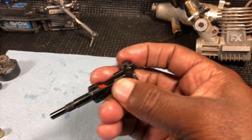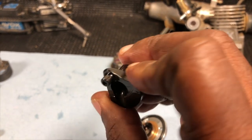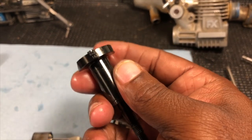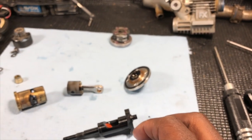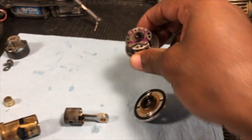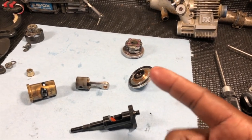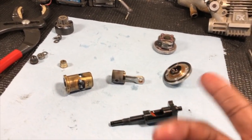DLC coated crank - you see the silicone fill? Nowhere on the pin at all. DLC coating is the way to go - trust me, people. I don't know if I'd want to run another engine without this coating. No kind of wear whatsoever on this crank. So it's looking good - buggy clutch, that's the bomb as always. Shoes still looking good, everything still looking good. That's the motor broken apart after about three to four gallons on that engine with that fuel, and no kind of wear, pinch still good, motor still great.